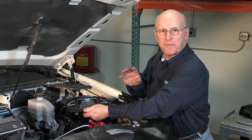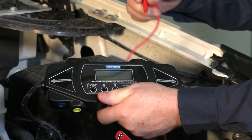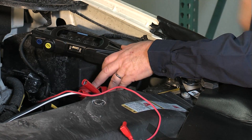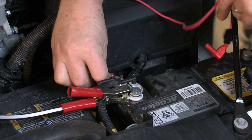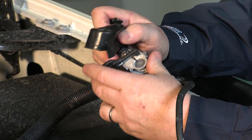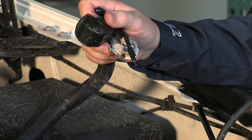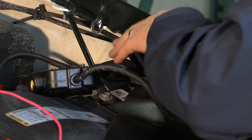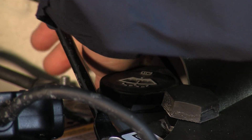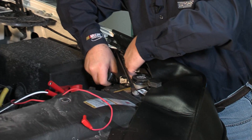For removing the unit, to keep it simple, the first thing I like to do once we've stopped the log file and we have our data secure — I'll simply go ahead and remove the power lead from the module. It's powered down and we're good to go. I'm also going to go ahead and take this cable piece and remove it off the positive terminal on the battery. Now because we've got lots of slack here, we'll remove this tape, undo the latch. The vehicle is now running on the power supply unit only. Now we'll take it loose in the battery terminal, spread that apart just a little bit, and put the module on the bench.